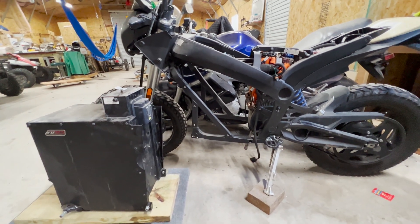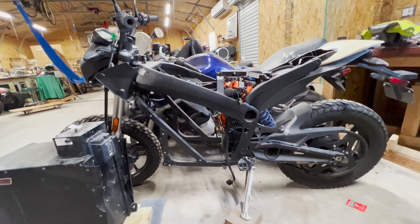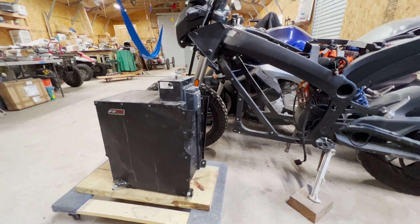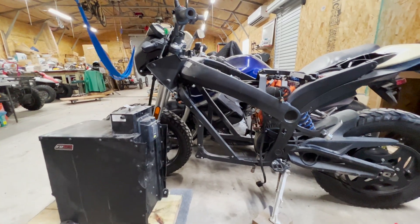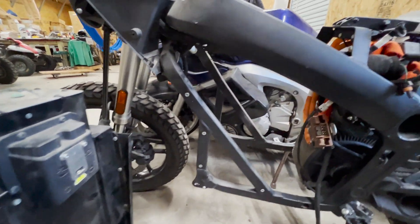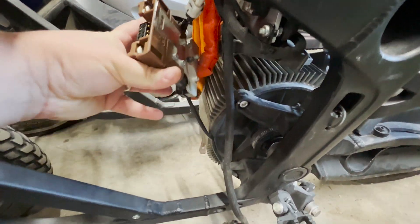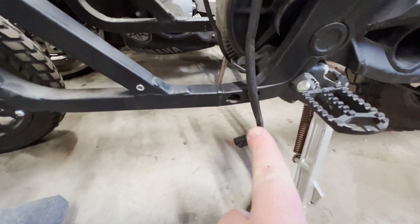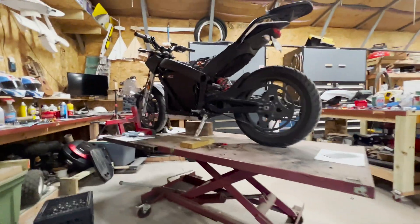When it's time to reinstall your battery, it's fairly straightforward — just the reverse of what we did. You'll need to suspend your bike or lift it in some way, get your battery on a stable surface, and then just lift your bike up and set it over the battery. As the battery goes in, keep it forward just a little bit so you have room to reach in and plug in the main connector. Then slide it back until you get your bolt holes lined up underneath — it may take a little finagling, just wiggle it around to line it up — then bolt it in and you're good to go.